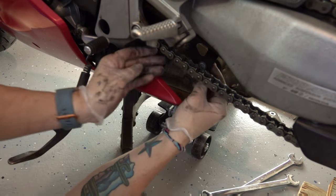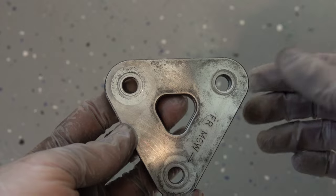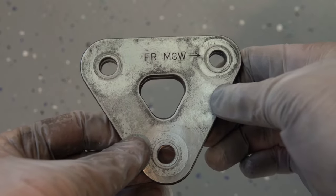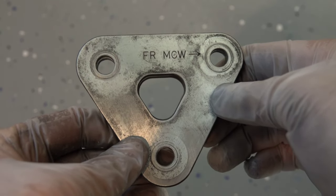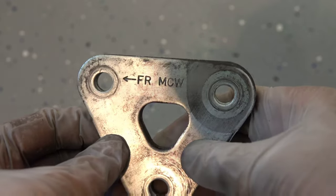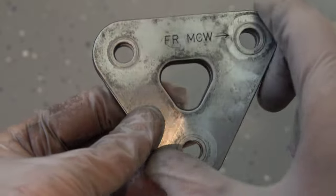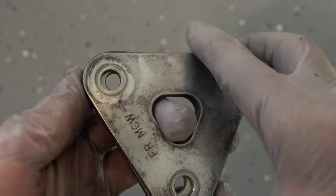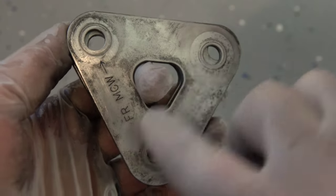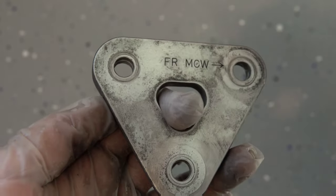With the swing arm now supported, I'm going to remove the triangle from this side. Something I haven't seen on the web yet — if you're looking at the bike from the right-hand side, which is the side of the swing arm that's open, the arrow is going to be pointing towards the front of the bike. If you're looking from the chain side, it's also pointing towards the front. I have them lined up here and you can tell they all match. If I were to flip one, you'll see they no longer align — that's because there's a difference in the distance between the holes on the triangle, and that's why you get the drop on your bike.